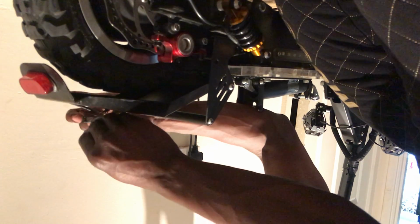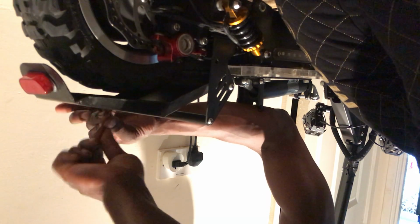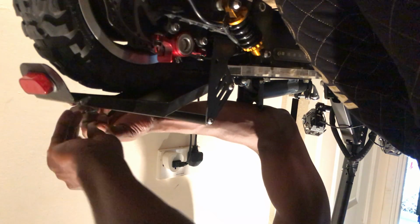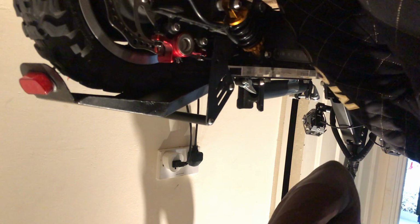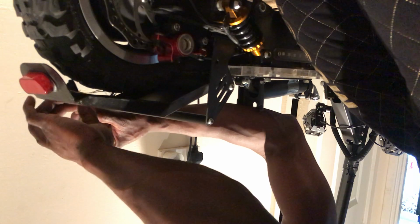So I look for red and make the wires ready. Don't let them split up into singles. Put them together and then put the one on top like this, and you go again. You turn clockwise until all the wires are turned well. Don't make it loose. Then you bend it over on that. Again, reach for your insulation tape, cut a little bit, and put it on again the same way.